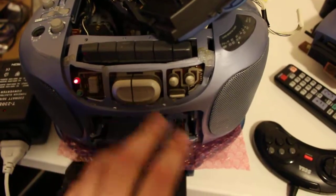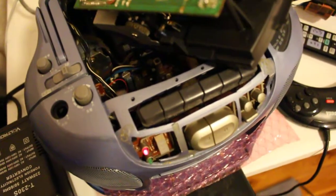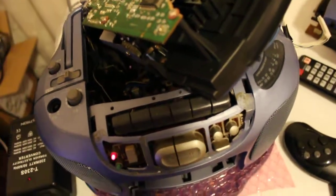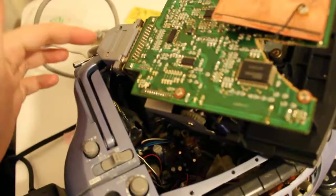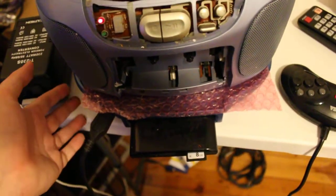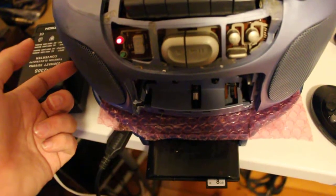One of them is probably the CD player part, which has a whole bunch of wires to control that area. The next is the Mega CD game part — from what I understand reading what it said on the main board itself: 'to CD game' and 'to game'. So the game part is the only part I've plugged in. The main board is pretty much providing voltage which runs out through this connector to the Mega Drive section, which outputs video and sound — actually, I'm not too sure about sound; I think sound comes from the main board.